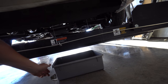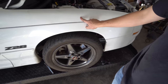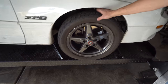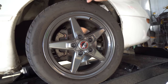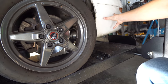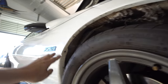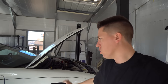The sixth thing I don't like on this car is the exhaust. I built this custom exhaust — it comes out and wraps up along the fender, and it actually kind of pushes on the fender, which is why the gap is off. I had to smash it and raise the car, and it still touches going through dips. Under full power if the car wheelies I definitely don't want it touching there — it's a safety issue. I'm going to get rid of it and figure out a new route, maybe bring the exhaust out up front as bullhorns. It did knock some sound out and had a muffler past the firewall which fit the no-prep true street rules, but I'm not running that anymore.